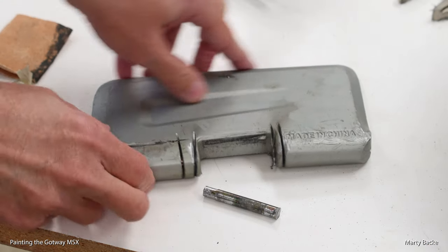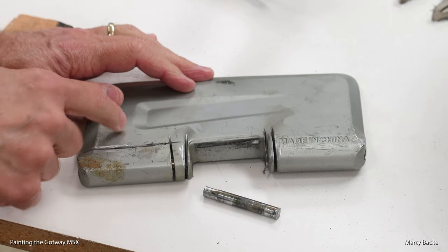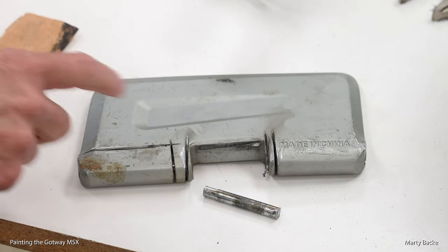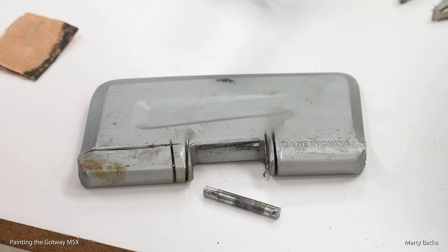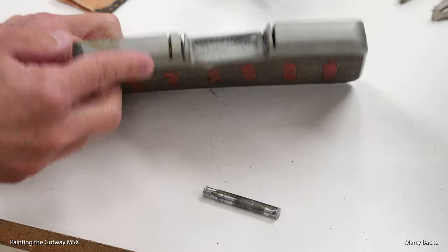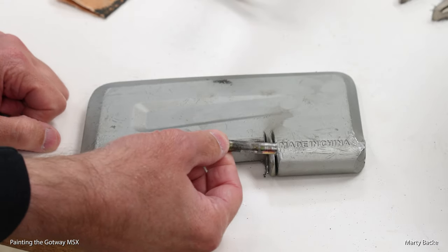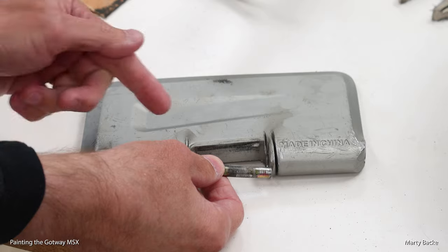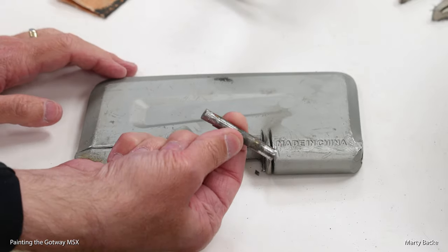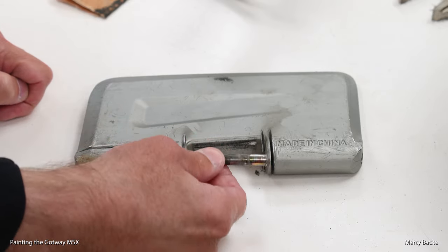Here's the aftermath of cutting up this pedal. These pedals are really tough — unless you get a defective one. I mean, they have broken in the past, I've seen that on Kingsong wheels too. I think it's just a defect in the manufacturing process, because in general they might bend and stuff but they are tough. I was hoping I could cut the pedal away and get the pin out, but it just didn't work. I had to cut here and here, and it still took a lot of work to get the pin out of the pedal hanger.